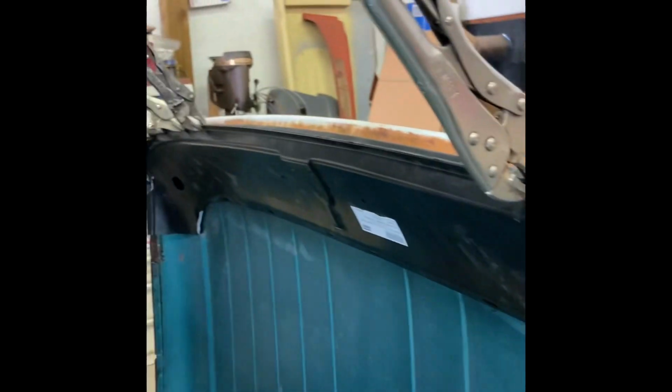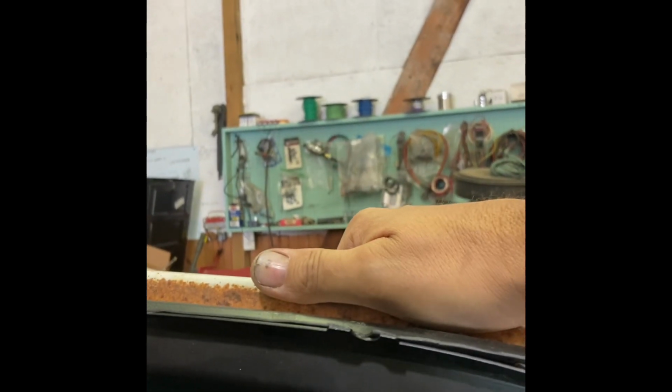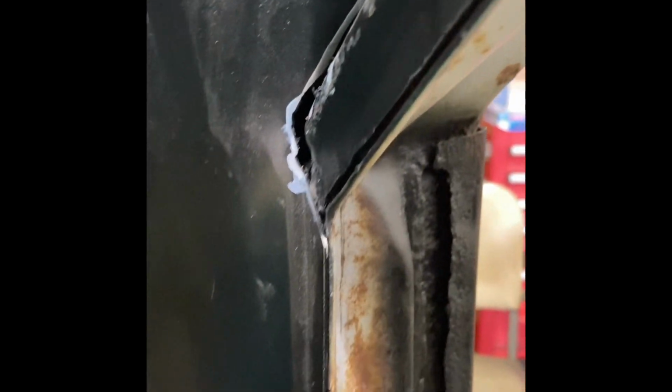The second most important is, you need to be able to have something you can live with down here on the ceiling. So up here on top, I'm gonna pull this panel off, and both mating surfaces where I'm gonna have the panel bond, I'll buff them down to bare metal. On this side and the inside of both of these pinch weld areas, because even though that 3M panel bond will stick to a lot of paints, you do get the best bond on bare metal.